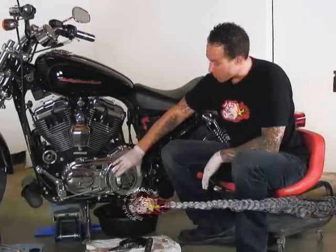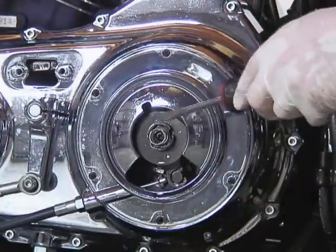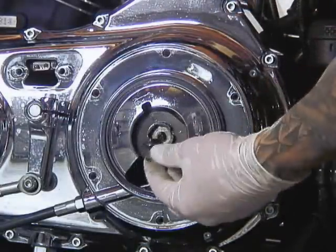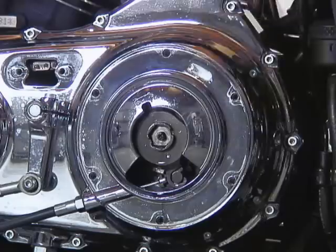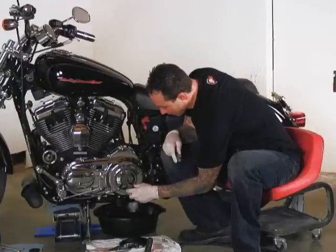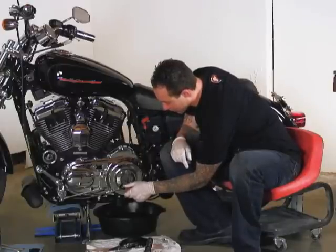Now if you look at the clutch, which is right here, you're going to find our clutch adjuster. It's going to have a spring right here and a locking nut — this actually just locks the adjuster in place when the cover's on so it doesn't move back and forth. So if I take a flathead screwdriver and back it out counterclockwise, it should lightly seat. And when it lightly seats, that's its starting point — you want to turn it one quarter of a turn in, and that's going to give it the proper amount of operating free play.